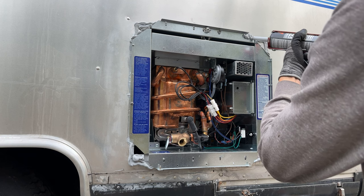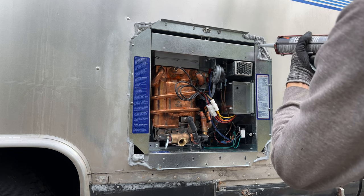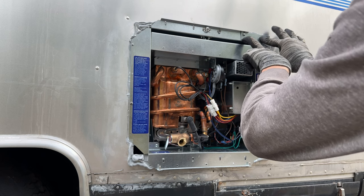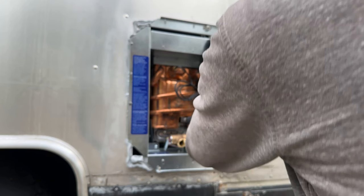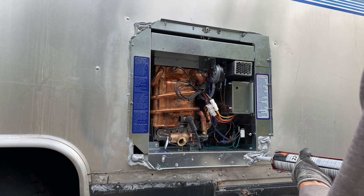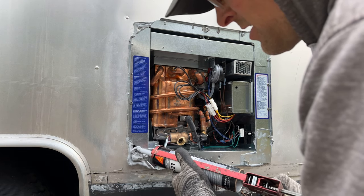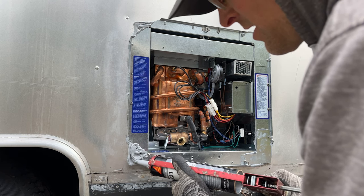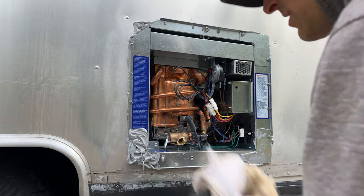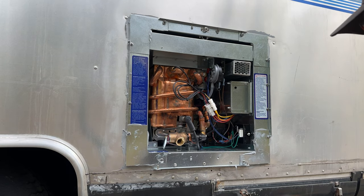I'm going to add a nice bead right back into that same bed — a hearty little amount, I'm not shy with it — and squish it. I'm just pushing a bunch of this Sikaflex into that big gap, and the corner is going to push on it so I'm not too concerned. Try not to get a bunch on your trailer. I'll do a little mineral spirits wipe-down.